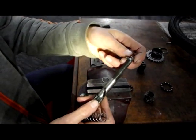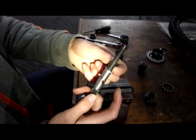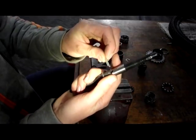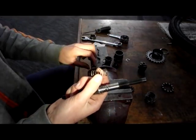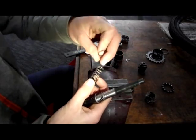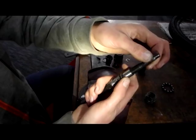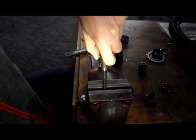To reassemble, you need to put the large spring cap on right up to the end of the spline, then the washer, then the large spring. Pull the spring back and insert the pin so that the keel faces the spring to act as a self-centering device. Then you need the small spring with two black end caps, and slide that onto the axle. Put the bell housing on and flip upside down.